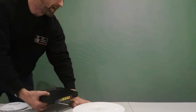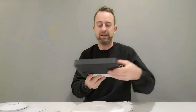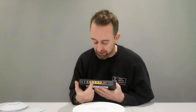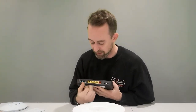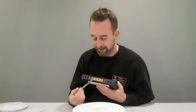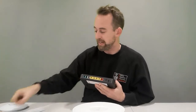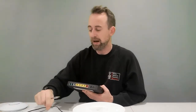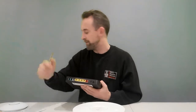Let me just show you quickly with a router here. The ports you would plug the LAN ethernet cable into are normally yellow on the back of the router — these are your LAN connections. You take this ethernet cable, go from there straight into the access point, and then you've also got the power cable. Since this router is not providing PoE, you would still need the power cable in that scenario.